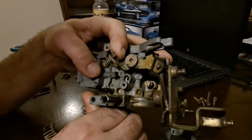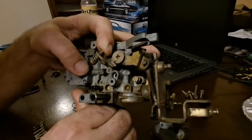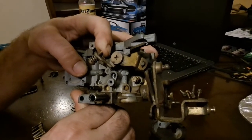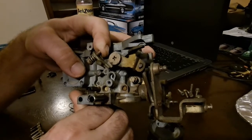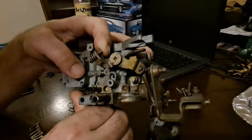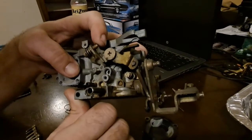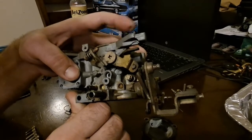Another thing that happens is people get in here monkeying with these things and they bend the tabs. You see how this has got this weird angle to it right there? That should be straight. So I've either got to replace that from a donor carburetor or straighten it out. But that's what operates the cam on here that rides on the fast idle screw. If you push on this, it opens the throttle blade a little bit. When the choke is set and it's at fast idle, the throttle comes open just a little bit, and then as it starts to warm up, that bimetal spring turns the lever and this ever so slightly decreases until the throttle is at low idle and the choke is all open.